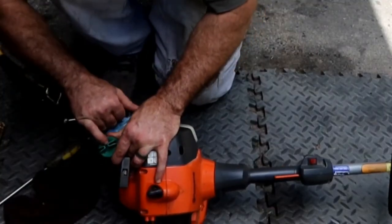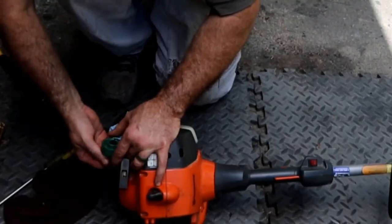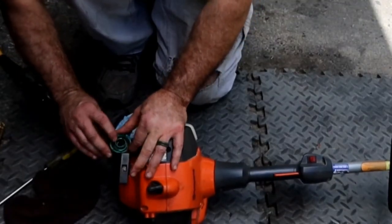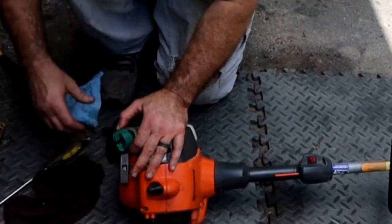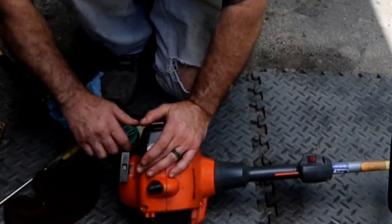So I can see the screen that's in the bottom of that. It tells me most likely I'm pretty well clear. There's no significant dirt, debris, or whatever inside that part of the cap. Anyway, air's allowed to come in. That's the vent, and it was dirty. Could be the problem. Let's go ahead and put that back on.